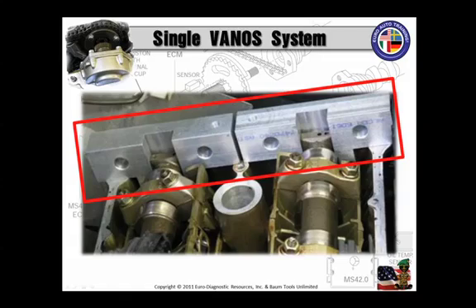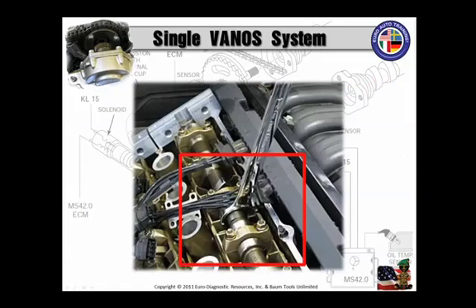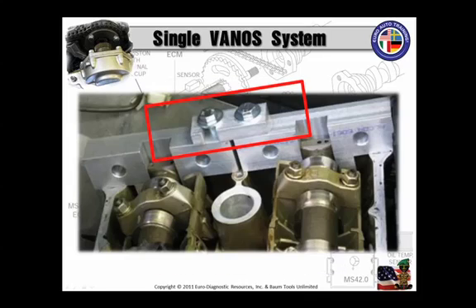Warning — these camshafts are delicate and fragile, so don't break them. These locking tools are aligned with the ends of the camshafts properly. Time to lock them down permanently, but before you do, grab that 24mm combo wrench and get it into the cam to rotate them just to make sure you can fine-tune those locking blocks in place. Don't take a hammer to the locking blocks — they should fit down there snugly using your hands. Use some finesse; don't be a gorilla. Complete that by locking down the securing locking blocks. Now you're ready and safe to remove and disassemble the Vanos unit in its entirety.